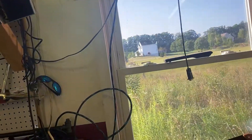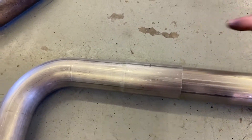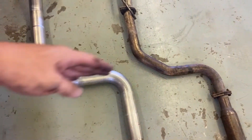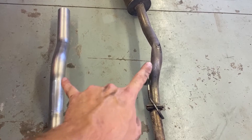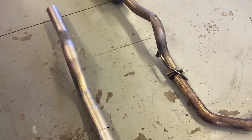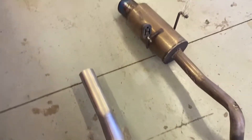The length of this pipe is semi-adjustable because there are slip joints about that long and you can extend it as needed — it doesn't have to be bottomed out. If you look, we've got a straight line through that pipe, and you can see the axles are in two different places. We need to extend this back a little bit. Once leveled up, it's pretty even — pretty good. So what we can gather from this is that this exhaust will fit. It's a Speed Factory part — not inexpensive — so it should fit just fine.